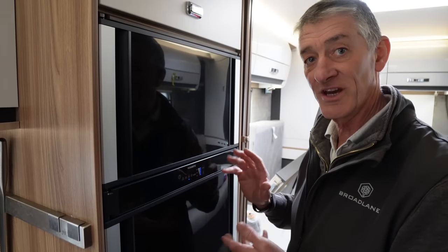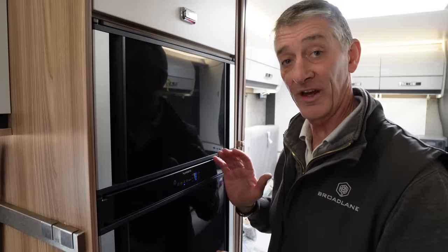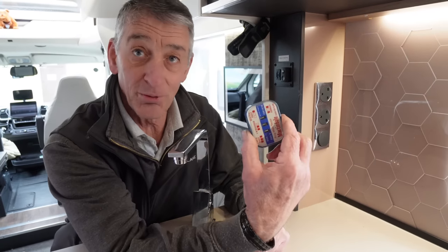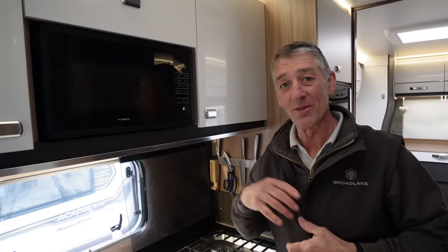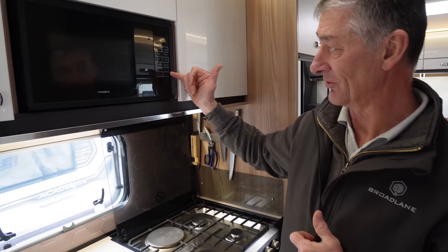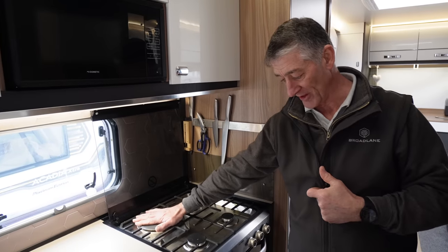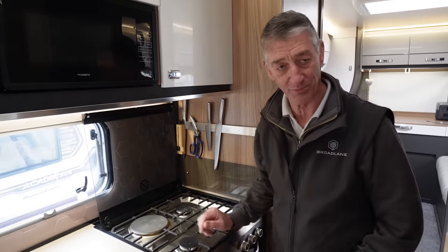Testing the refrigerator — we test it on 230-volt mains, 12 volts, and also on the gas side. We test all the mains sockets using a simple mains tester to make sure we've got the correct lights illuminated. On the mains side we also test the microwave for its operation by putting a small amount of water in a cup and turning it on, and similarly the hob — there's an electric hob ring and a test valve for testing purposes.